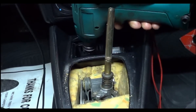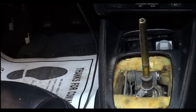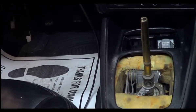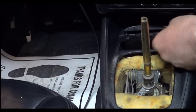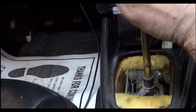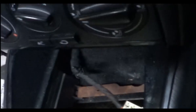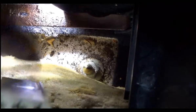I don't know if you can see the screw down in here or not, but there is a screw down in here. This one's very rusted. After this screw gets taken out, you have to work the ashtray area out. This should have an ashtray in here that's missing on this car — obviously the guy's a non-smoker. So I couldn't show you removing it, but it just comes right out. You have to be careful — there's a metal rod that goes from one end to the other. It pops into some plastic parts that are pretty delicate, so you don't want to bang the end of the cigarette lighter into it and break those plastic parts. That should leave us access to the two bolts inside here — removing the ashtray area gives us access to the two bolts we need to pull the shifter out.